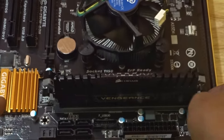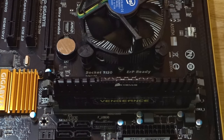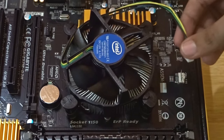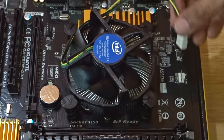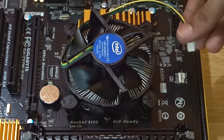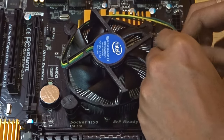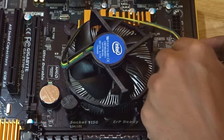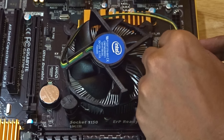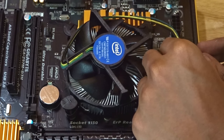After fitting these two things, connect the processor heat sink to the power connector near the processor slot on the motherboard. Take the four-pin heatsink connector and connect it to the pin near it — this will power up the processor fan. A main tip for gamers and overclockers: when you're going to use a processor, throw away the stock heatsink that came along with it. It's not that efficient in thermal cooling compared to a custom liquid cooler or copper cooled heatsink system.